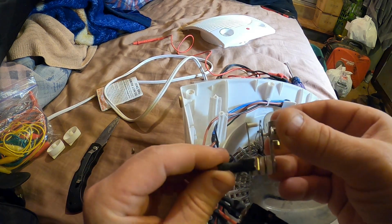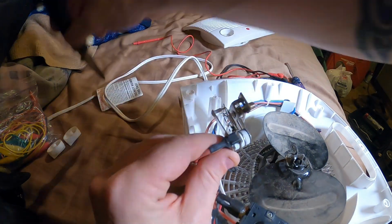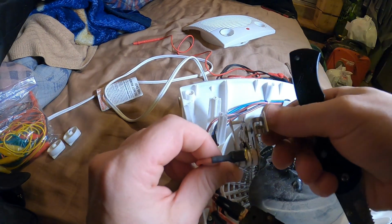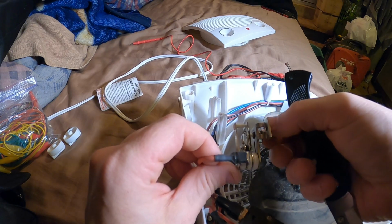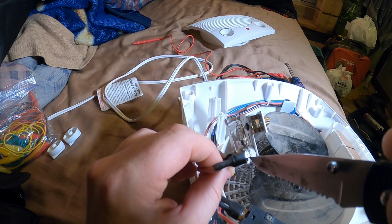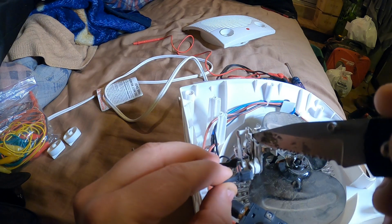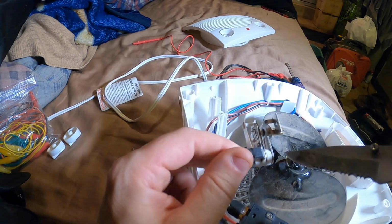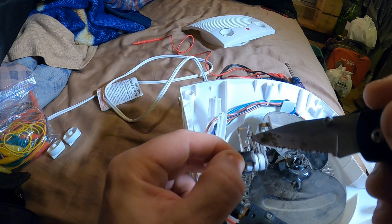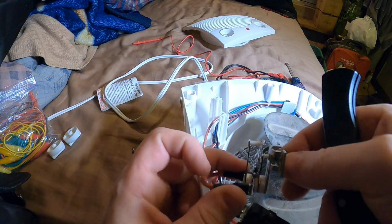Thermostat, a little thing there. Let's see, oh, there's the clicky part, the contacts. Those actually look like they're engaged. Power into there. Looks like there might also be a built-in safety mechanism to that. Power in. Across this. Looks like it's stuck on.